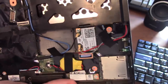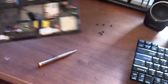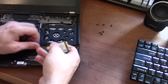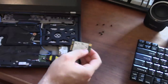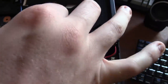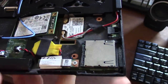There's a chance you already have an mSATA card in there, in which case it will be screwed in. Unscrew it and it will pop up so you can pull it out. We're going to do basically the reverse now. Take the mSATA drive, move the Wi-Fi antenna wires out of the way, and plug it into the slot — it goes in to the left. Notice it sticks up at an angle — that is how these drives properly plug in. Make sure there's nothing behind it, then once it's seated nicely, push it down.